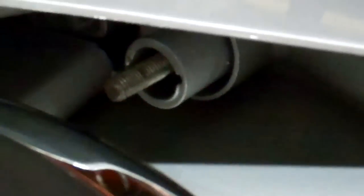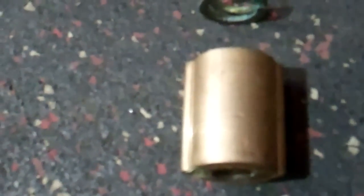Once you've got the bike apart, the first thing you're going to do is put this rod through the frame sleeve like so. There's a hole in the top of the frame sleeve and that's going to expose it — the rod will come all the way through and expose the thread barrel. Once you get that showing, you're going to put the foam washer on, then the spring, then screw on this brass spacer.